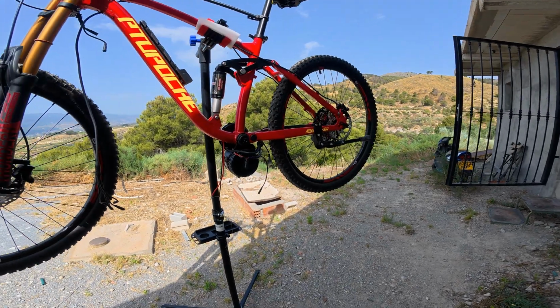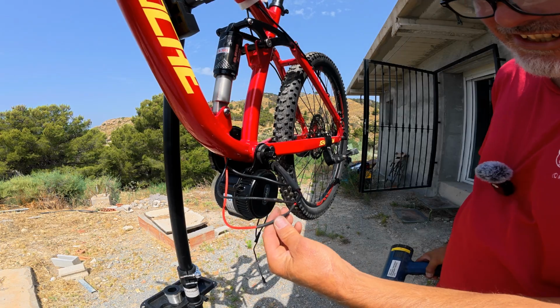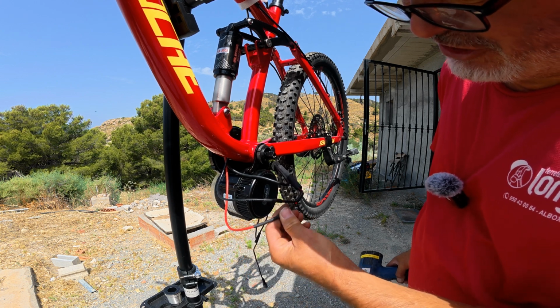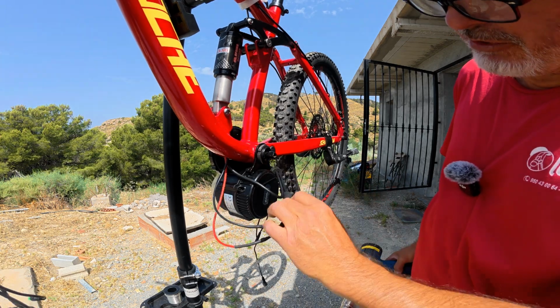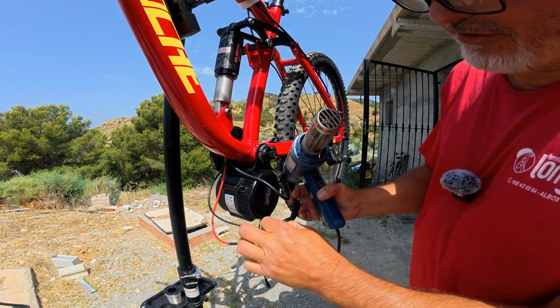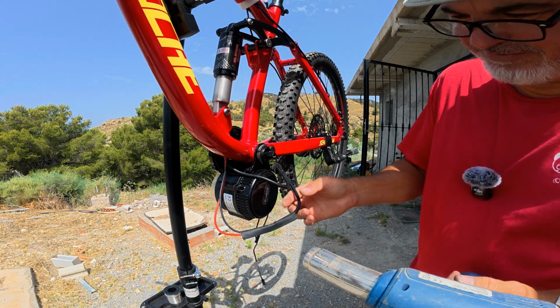Okay, so I'm going to solder these. I'm not going to film that because you've already seen a bit of that, and then I'll bring you back in. Okay, so that's them soldered. I've double heat shrunk them just to make sure they're well sealed and they're not going to bind into each other. Now I'm just going to take one piece of this thicker one, take it over the two joints. That's it, and I'm just going to heat shrink the lot.